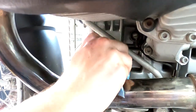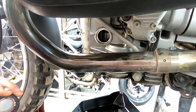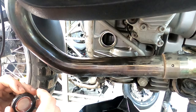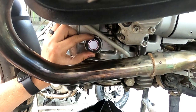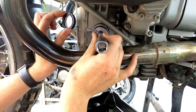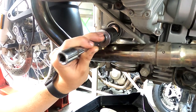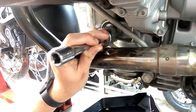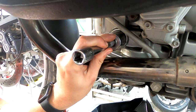I'm using some brake and parts cleaner to clean this out — get any rubber debris or anything out of that bore. If you scratch that bore you can put a little bit of RTV silicone on the sealing surface, which will also act as a lubricant so it slides in nice. This part can be a little tricky. I'm using a 30 millimeter socket, which is about perfectly sized with that bore, making it a really good seal driver. We'll gently tap it in, keep checking on it, and tap until it's completely bottomed out on the back side. Keep checking to make sure we're going in flush — I can tell I'm a little off to the right side, so I'll tap a little more on that side.